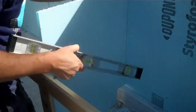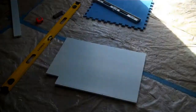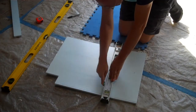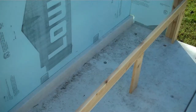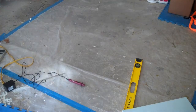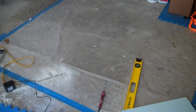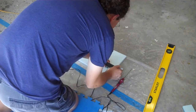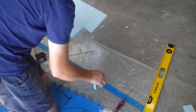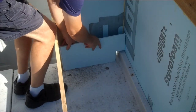When cutting the top of these interior seat supports, I am also sloping them forward to shed water off of the seat. I'm using a hot wire cutter, but it is best for small or non-straight cuts as it's slower than a razor knife. The sole purpose of this small piece is to have something to attach drawer sliders to for the slide-out fridge drawer.